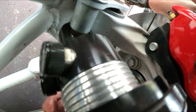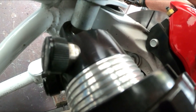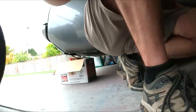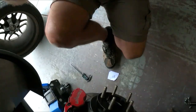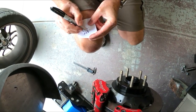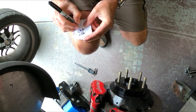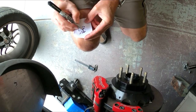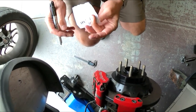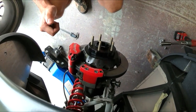It's just two washers. I had to finagle this a little bit. So I'm going to kick that shock over just a little bit. It's almost vertical, but you won't notice it if I kick it back a quarter of an inch. So out of this 934, I think I'm going to take 200 thou out of this, and we'll go 734. And we'll add it to here, and we'll go 367. These are lower, rear, and these are uppers. Then we'll measure the other side once I get the other wheel off.